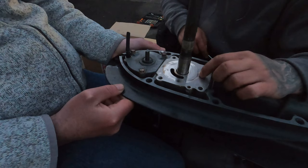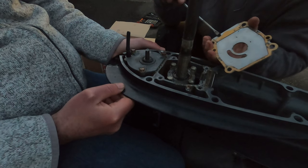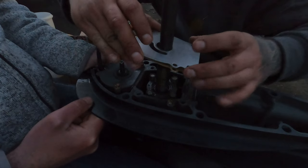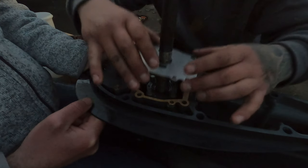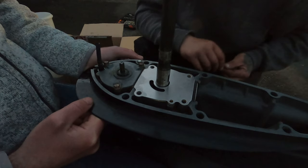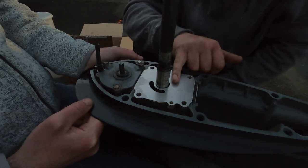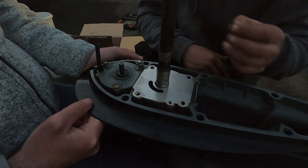What we're going to do is take this plate off as we've got a new one in the kit. Underneath here you also have a gasket, and we've got a new one of those in the kit as well. Give this surface a quick clean around here, we'll get the new gasket on and the new plate and get it all put back together. Just installing the new gasket now. The gasket has got a little lug on this side — drop the gasket in, drop the plate in just like that. Now that's ready for the impeller. Another thing we've got in the kit is a new woodruff key — that's the actual name of it. We'll keep it on this side of the engine away from the slot. You can add a little bit of grease to this to help it stick in place — push it inside there like that.